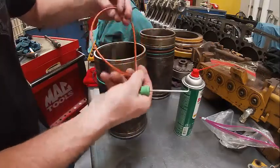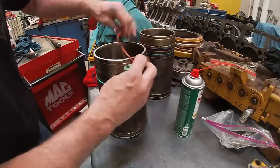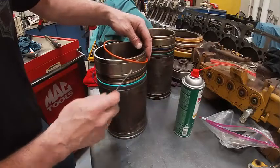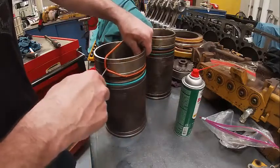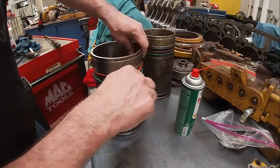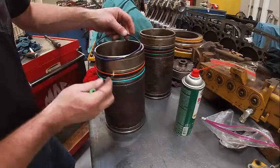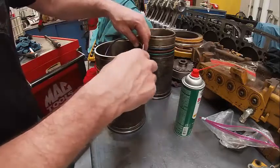The orange one is next. What's the orange one say on it? It says mid, so that makes sense. This is coolant, and this would do both. So they're multi-use O-rings, but you don't want to roll them on — you want to make sure that you walk them on. This one says oil, so it's pretty self-explanatory.